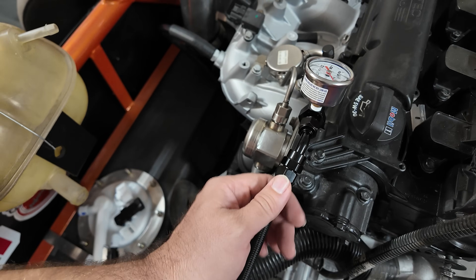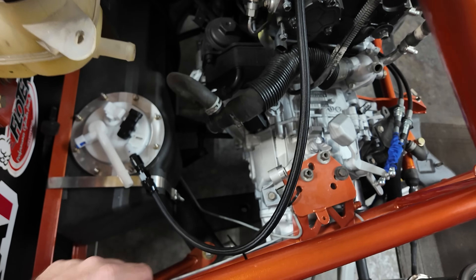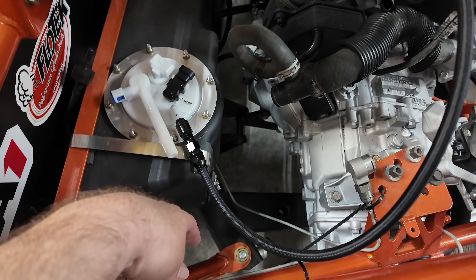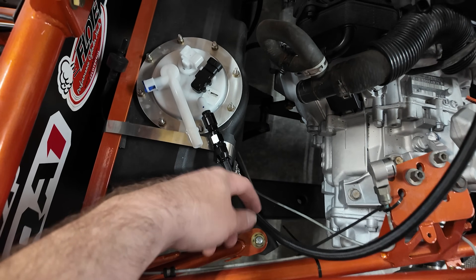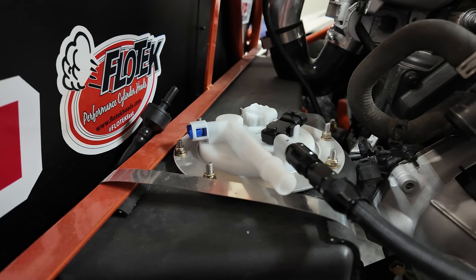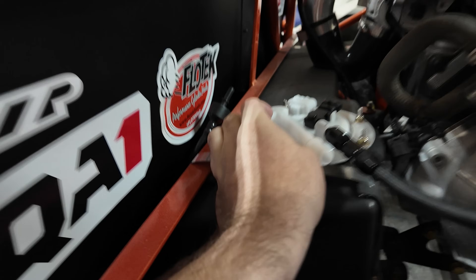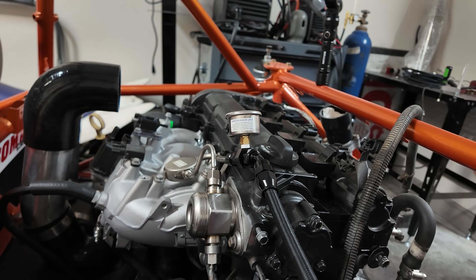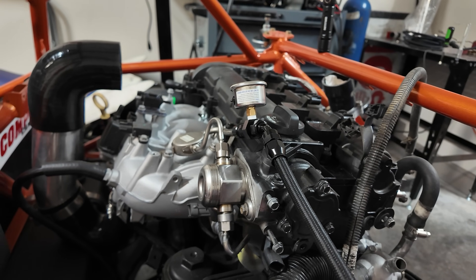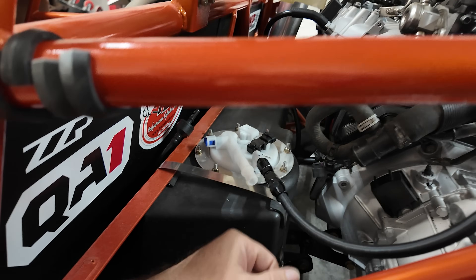Quick disconnect up here so we can do the hose. I know it's a little long, but this is for the long term — I don't want to keep replacing it. If it gets chafed, we can cut it there, shorten it up, adjust it, and quick disconnect here. Now we still have what I call the overflow — not really the right name — and the return, which is right in there. The LNF does not recycle fuel like the other engines that aren't direct injection. I believe the LDK does as well — it recycles unspent fuel back into the tank and then through again. The LNF does not.